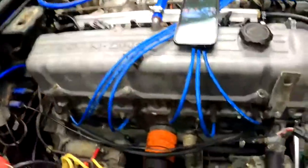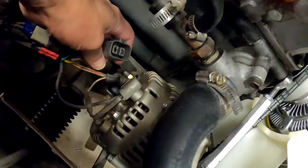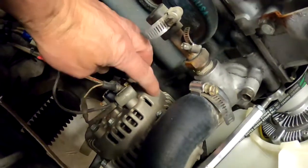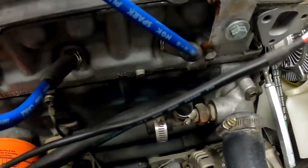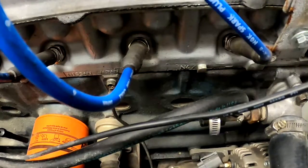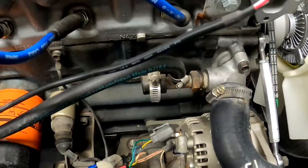I have disconnected the plug from the back of this alternator, which is a 1985 300ZX alternator — I believe it's a 70 amp unit. The 280Z is only 60 amps, so if you want to upgrade, the simplest option is to get this alternator.